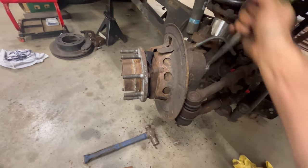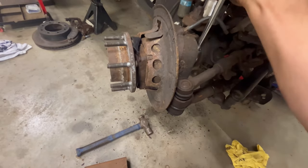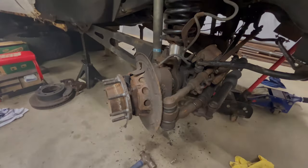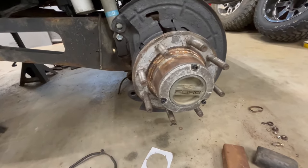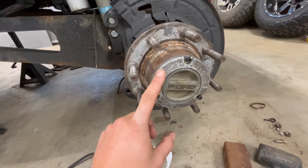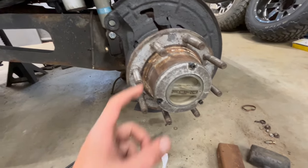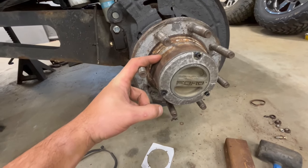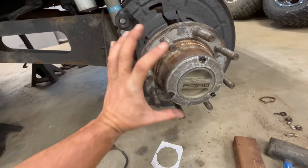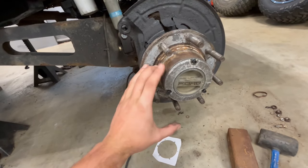Got the dust cover back on, the bearings in, new seal, O-ring was put in here. Just working on the last nut here for the four studs. Slow and steady, getting all these back here. Taking my time because this has been apart for a little while - just making sure I don't forget anything. Put some never-seize on these nuts because last time I had a hard time with it. I'll get those torqued. Got the passenger side hub locker in. I don't have the screws tightened yet. This was painted, so I cleaned these up - a little scaling off on the inside and outside. Inside right here where the axle shaft comes into the receiver, I whacked that full of grease, and where the auto four-wheel drive gears slide back and forth with all the springs - whacked that full of grease. So that's all good in there.